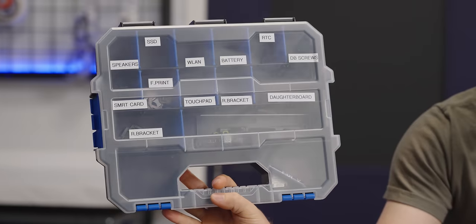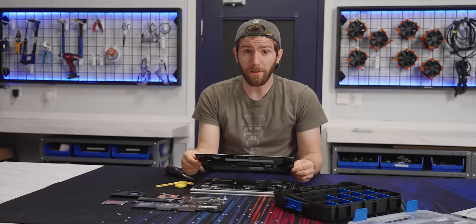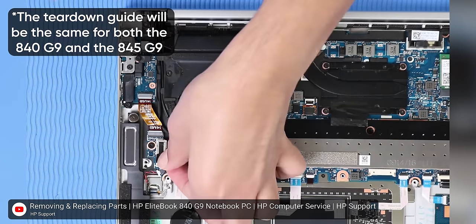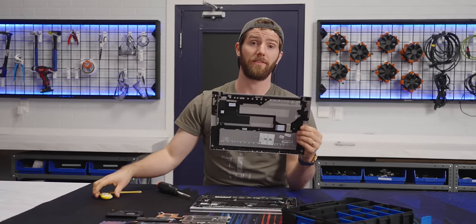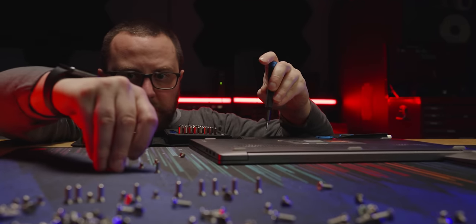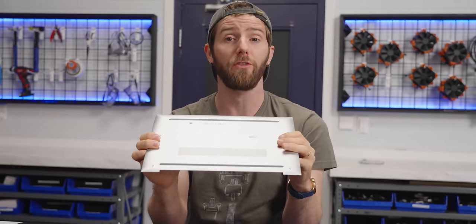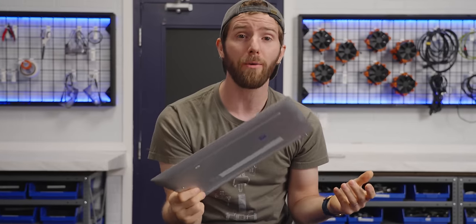We've got one of literally every single part they offer on their online store to replace. Another aspect of this serviceability angle is that HP's YouTube channel has proper guides for everything I'm about to do, for this and tons of their other devices. Right out of the gate, just five captive screws is all it takes to get inside. Every extra screw or rubber foot in the way is another potential point to give up and not choose repair — or if you're a service tech with a big deployment, every screw is 15 more seconds, maybe dozens of times a day, costing you hours. I really like this no-nonsense approach to getting inside.